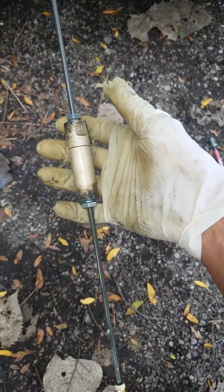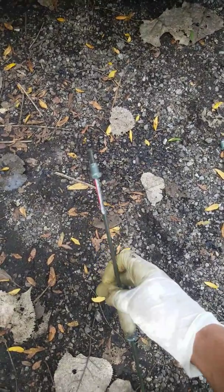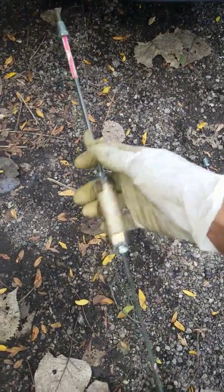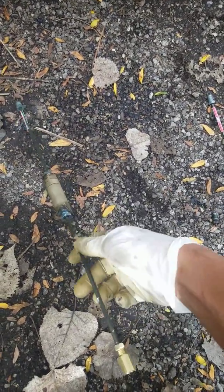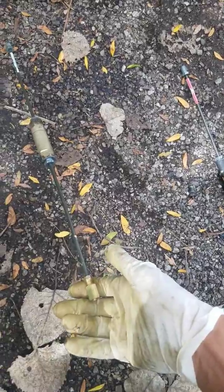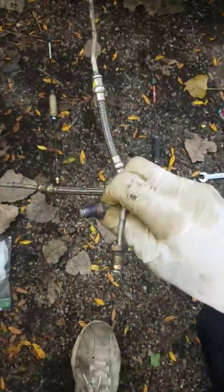Both of these lines are different sizes too, so you've got to be careful. This one goes into the brake hose. What I'm doing is I've got two small lines already pre-made that go into the hose, then I've got another two lines with the correct fittings. I'm going to go from the bigger one to the smaller one and then run the line all the way to the front. I'm going to reuse these fittings because they don't have them at the store.